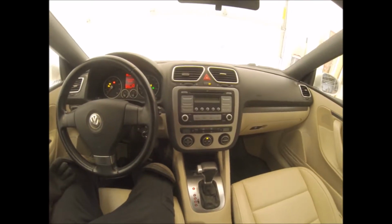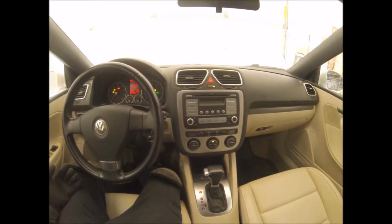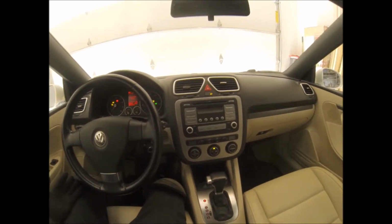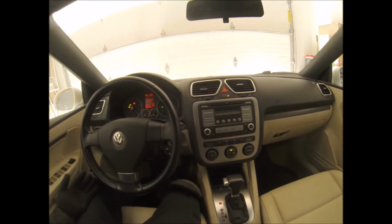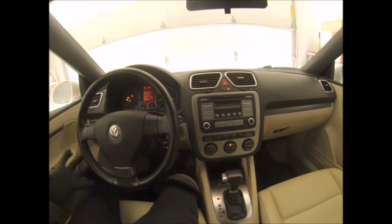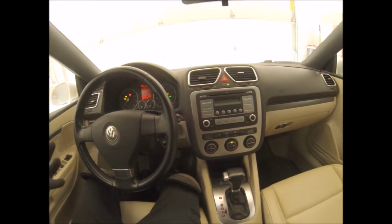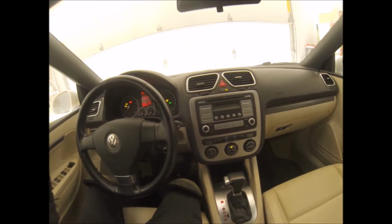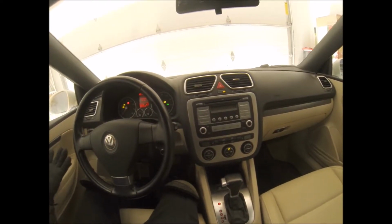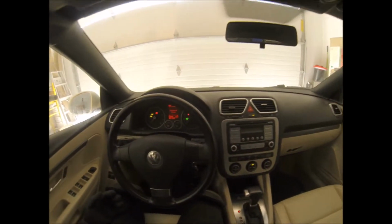And a humming noise could be grinding pads, rotors, or hub bearings. So I took it for a drive. He's right. At any speed, the faster you go, the louder the humming is. Sounds like grinding to me, but there's humming on both sides, left rear and right rear. He swapped the tires from the front to the back, and then back to the front, and the same thing. The noise is still there.